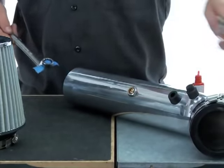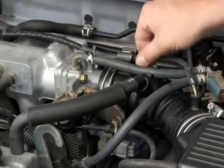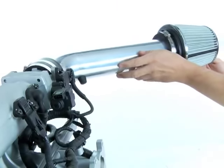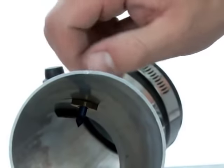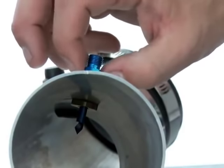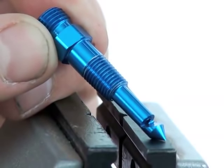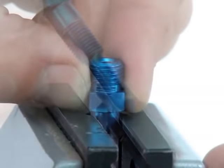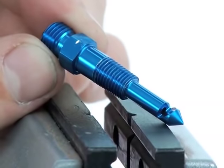At this point, make sure your entire intake assembly has been reassembled and tightened properly so we can install the nozzle to its new home. The nozzle will thread into place and needs two things for a proper install. The first is to mark the exposed area of the nozzle that should face forward. Before installing, look at the exit direction of the nitrous from the nozzle and directly above it, etch a mark in the exposed area of the nozzle so that as you thread it in, you'll know where to set the final pointing direction of the spray.